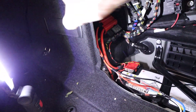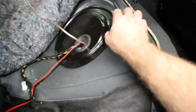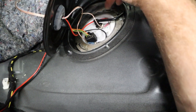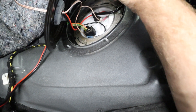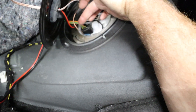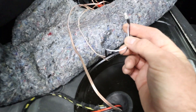This is wired through the hole here under all the paneling, properly wired and properly hidden. It comes over here to our fuel pump underneath the seat. So we're here at the fuel pump — going to take this cover off. Here are the two thick black and red wires: one's going to positive, the red obviously, and negative black goes straight to the terminal. Positive goes to that relay I showed you earlier.